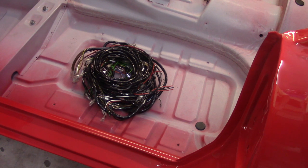I'm going to start playing around with this and route it. I have not unraveled this at all. I did not mark any of the old wiring harness when I took it all apart, so this is going to be essentially using the diagram and seeing what trouble I can cause. Most of it runs down the driver's side of the car, and it swaps over to the passenger's side as necessary to pick up taillights, turn signals, and things like that.